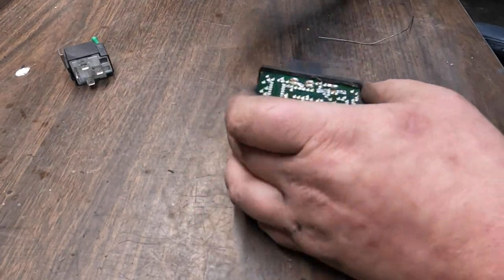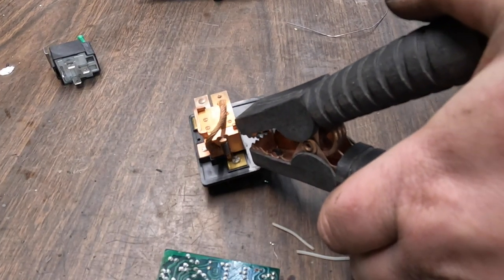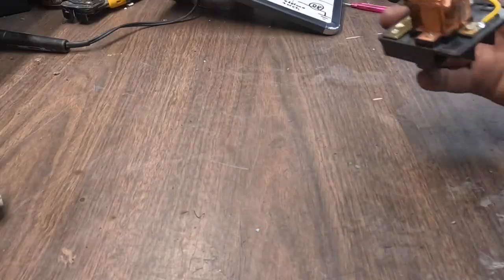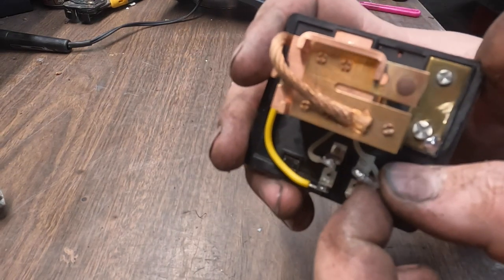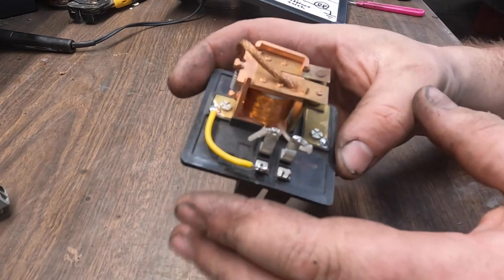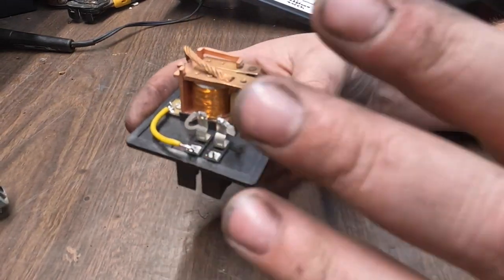We'll have one wire to run it, one for the indicator on the dash, and then maybe one dead pin. This is held on by these solder tabs. For figuring out the positive and negative of the control circuit, I got my jump pack — first try, guessed right. So that's the negative, that's the positive. Here is what I came up with in the end: the control circuit just soldered to these two contacts, with some Shoe Goo on there to keep vibrations out of that tiny single-strand wire. Also took from the output side of the relay and hooked it into a terminal for the glow plug dash light, so you know when they're lit up. That way if the relay isn't closing, even if you have the switch on, that's only going to light up the dash light if the glow plugs are actually getting warm.